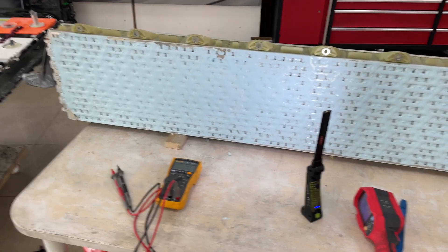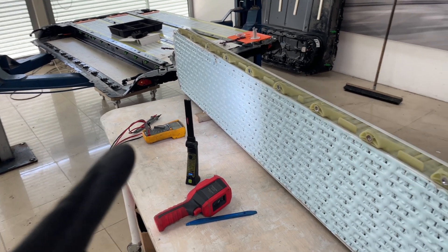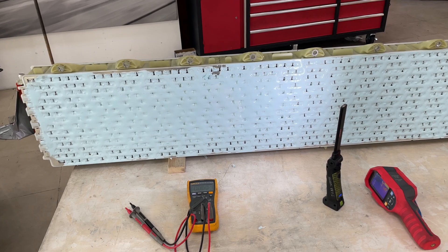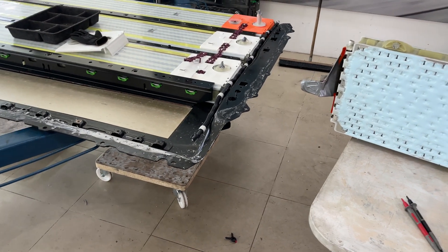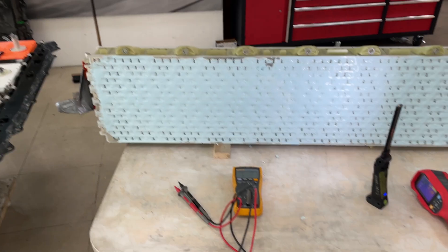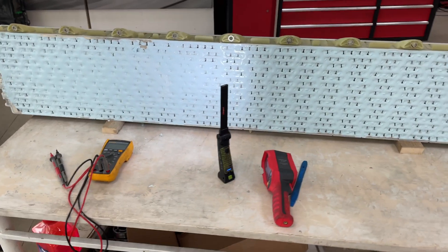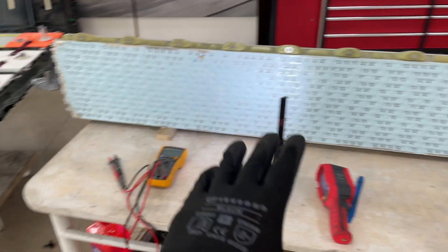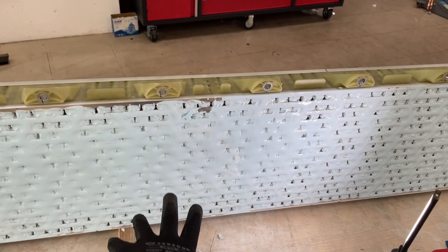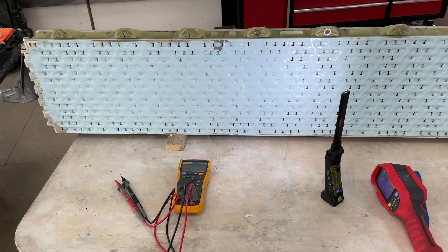We are making our own tool for cell extraction and we will save this complete battery pack, which is worth around 9,000 euros plus tax, by changing only one cell. This is the first example and we will make an EVC Academy training and operation manual for this. We have two cars with the same problem: this one with 150,000 km has water ingress, and the second one with 250,000 km is a standard range with fewer cells in parallel per brick. We will put this long range battery pack inside the standard range car, program it, and then repair the second one.